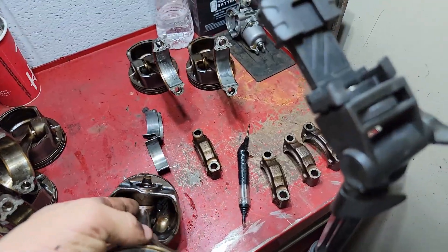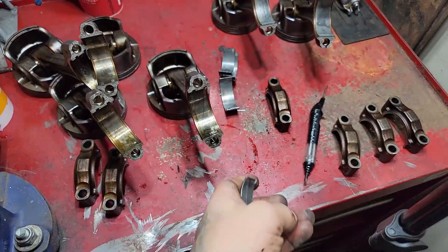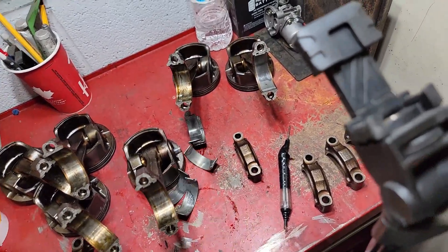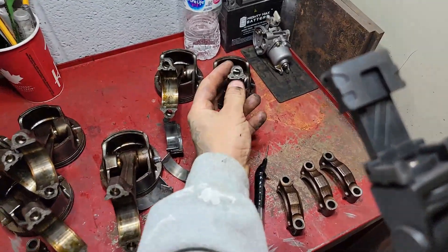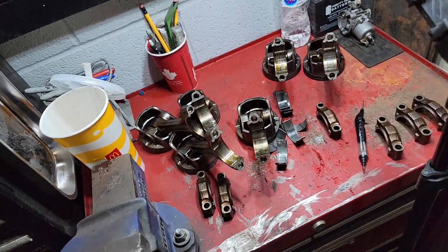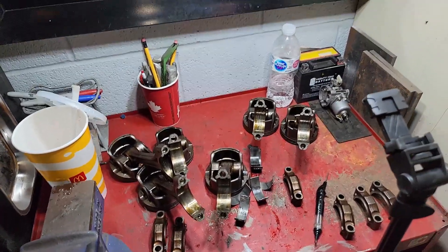That's why the table showing boost levels and corresponding ring gaps is so important — you can only go to about seven or eight PSI with stock gaps, which is boring. Since the engine is already apart, my intention when taking it apart was to file these rings down and actually make a reliable boosted B25 engine with cast components.